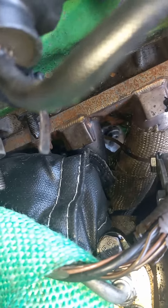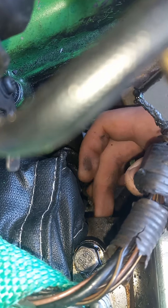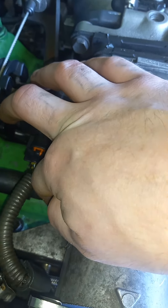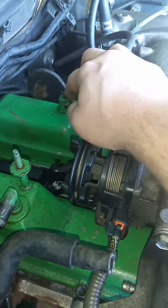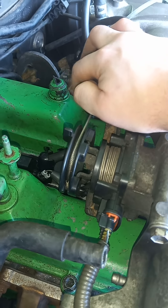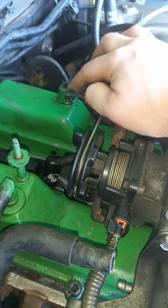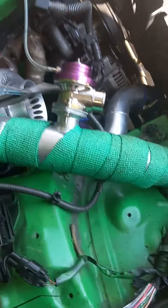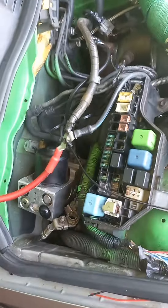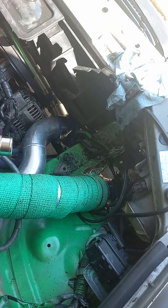The turbo is gonna end up getting water lines — I was just gonna run them off the back side of the throttle body here, to the turbo and from the turbo to where this goes down. For the catch can, I'm literally just gonna shove a dash-10 bulkhead down in there, trim it up so it fits really good, then dash-10 off this and clamp it on. The catch can is a little too tall to go up here or over there, so I'm just gonna zip tie it to the charge tube.